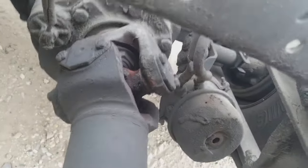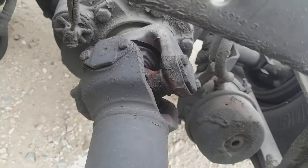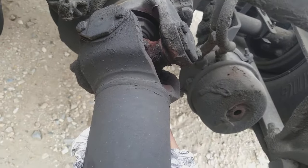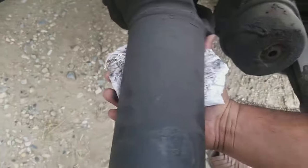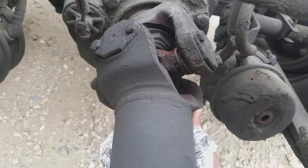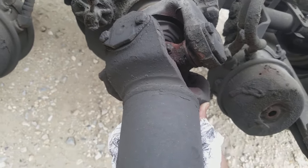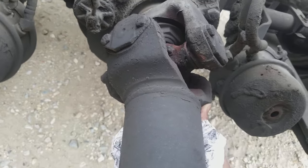You can still drive with it, but if you just try to pick up or pull on this drive shaft I can show you — as you can see, there's a gap and there's play when you move the drive shaft. So it's broken.